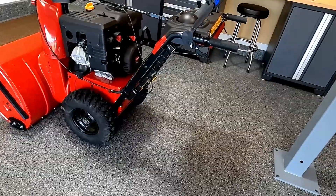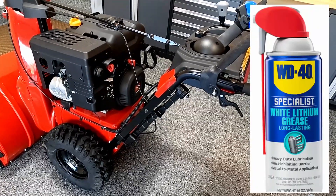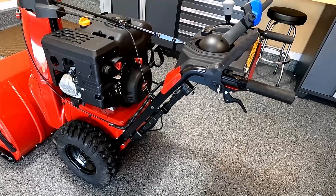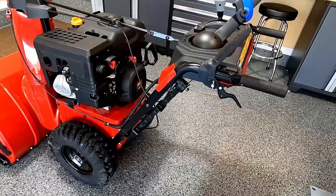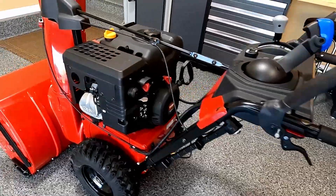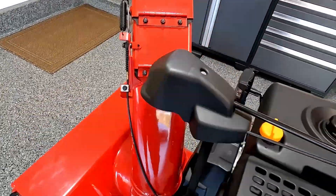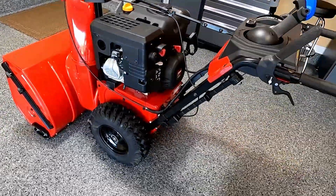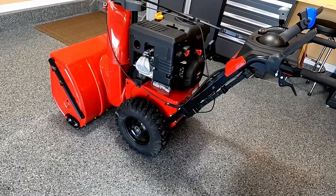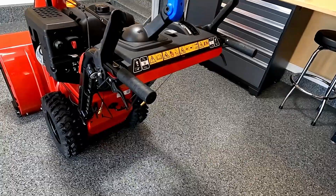Also while doing that thorough visual walk around, I'll typically take a can of white lithium grease and lubricate any of the related cables — the cable controls for the chutes, or the cable controls for the drive system. Any cable that goes into a housing, I want to coat it so it doesn't rust and keep debris out. Also on pivot points, like on the chute here, I put a little white lithium grease to keep them moving nicely and prevent rust. Even sitting in the shed for six months under a cover, everything should still be in really good shape.